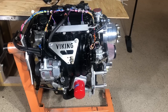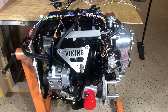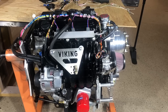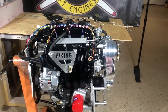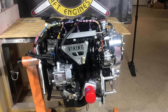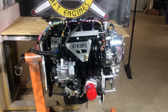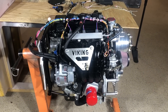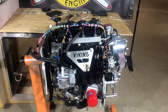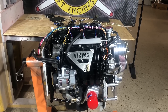So why do we bring up the Rotax engine? This engine was designed and created to serve as a replacement unit — one that can do the same job as the Rotax but for much less money. This engine weighs the same, has very much the same displacement, a very similar gearbox ratio, runs at approximately the same RPMs, and costs a lot less. Why does it cost less? Because this is a mass-produced engine made by Mitsubishi, used all over the world in many different cars. It has variable valve timing, liquid cooling, all-aluminum parts — aluminum cylinder head and aluminum crankcase. It's just a modern engine.